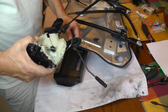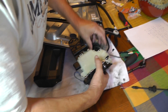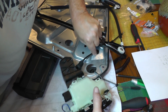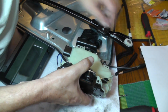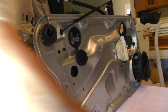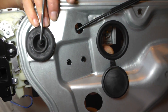With a little bit of support up underneath your door carrier, I'm going to slide the bowden cable in — actually, let me slide the linkage in first. Then I'm going to push the grommet back through the hole, and very carefully push it back through. Remember, all this is plastic, so be very careful. What you're trying to do is line up those two pegs in those holes. Then press on the very back of the module, making sure it is flush with the door carrier on both sides.